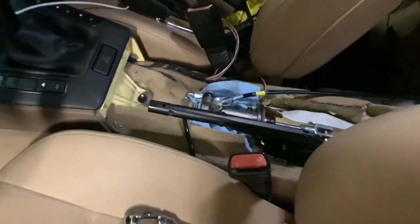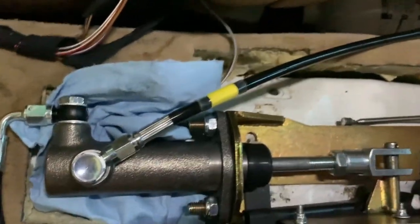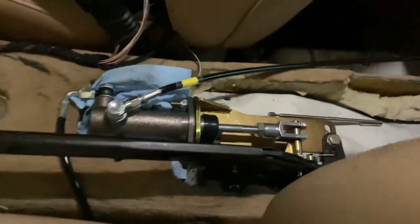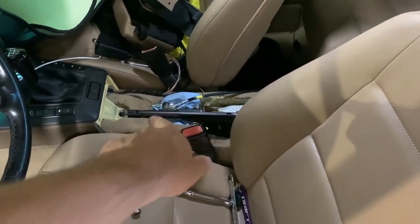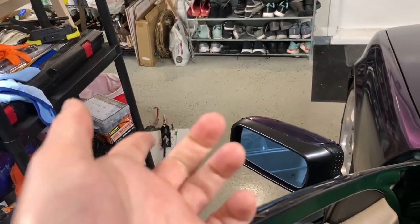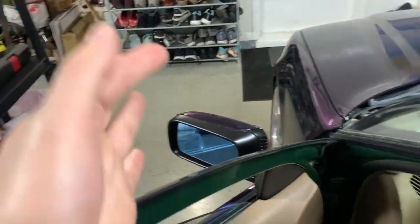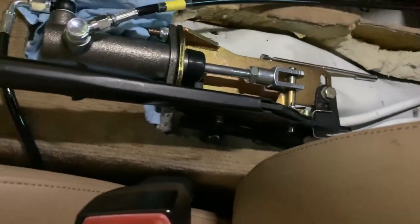The first step is taking the old one out. The light's kind of dying, but in here we've got three bolts mounting it up — one, two, three. I'm gonna take those out and move that one off to the side. I'll keep the lines connected because as soon as I disconnect them it's gonna piss fluid, and I need to mount this thing before I attach it. So I have to take this out and then make a bracket for the new one.